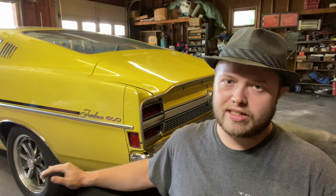And it's actually a good thing because it takes some of the pressure off the spring, so the spring isn't doing all of the work. It has a little bit of assistance, which is always a good thing. You don't want the shock or spring doing all the work all the time, obviously. So I just raised it up to the 26 even mark, and now both sides are dead set at 26 even, which is great because this car has never sat that level since I've owned it. So that's great. It handles terrific.